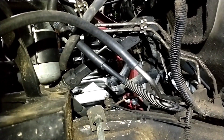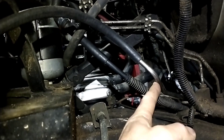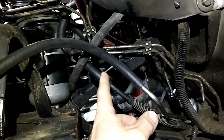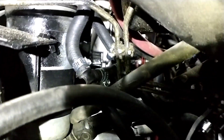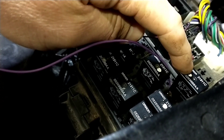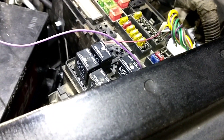These factory pumps will really do quite a bit. So I was just going to show you what I do to get it ready. There are the two lines going up to the factory fuel filter with the T in the middle - it's a bunch of hose clamps but it works pretty well. The only thing I do to set it up is I found the factory fuel pump relay and I'm going to wire that to key-on so it's on all the time, but for right now we're just going to go ahead and give it power.